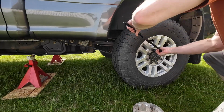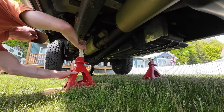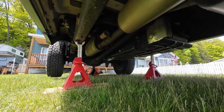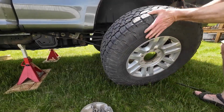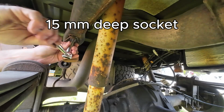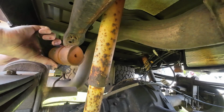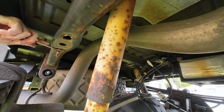After loosening the lug nuts, I jacked the truck up high enough to be able to get jack stands under the frame. With the weight of the truck resting on the jack stands, I can now safely remove the tires. The factory bump stops are then removed in order to make room for the airbags. The clip-in studs must also be removed.